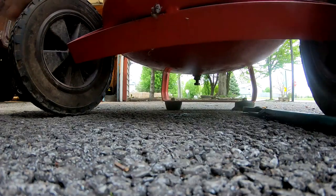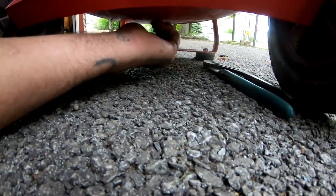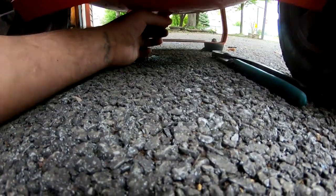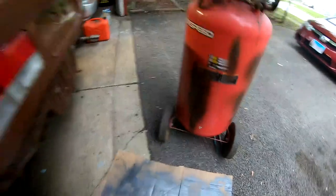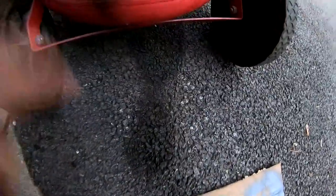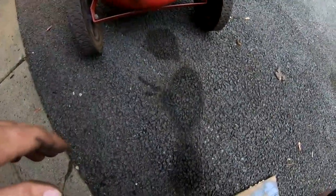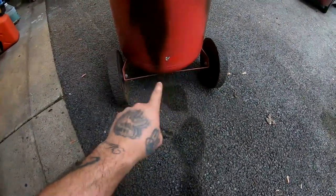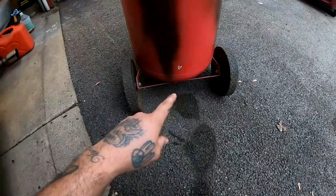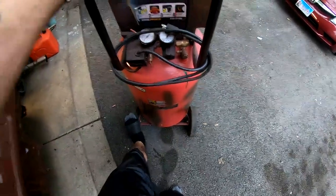It's not really that bad — there's not a lot of water coming out right now, though there's usually more. I'm going to let the whole thing drain out. You can see there's some liquid that came out — all of this was inside the compressor. Since I'm not painting until tomorrow, I'm going to leave that valve open overnight, releasing any moisture that might still be in there.